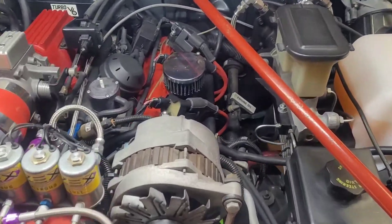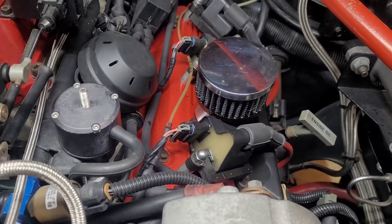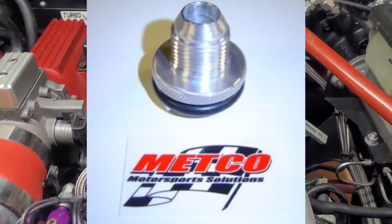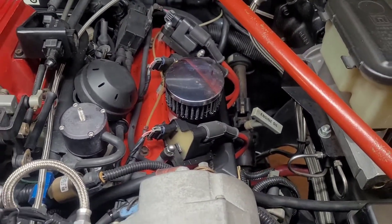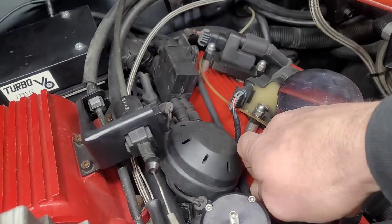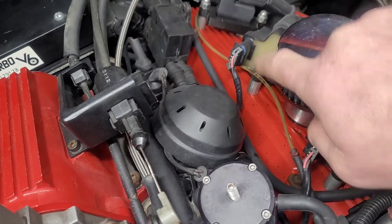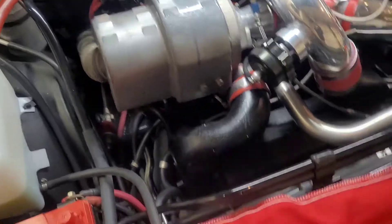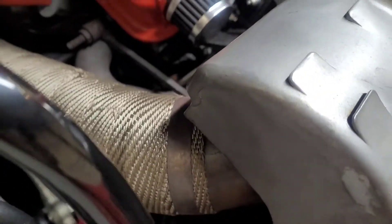For this vacuum pump, I'm going to remove the driver's side oil fill hole breather. When I go to change the oil, I'll obviously have to pull the AN fitting out and remove the line, but for as often as the car is driven it's fine. There's a film of oil that runs down the fins and down the back of the block and leaks everywhere. Over on the passenger side valve cover behind the turbo there's another breather that also has an oil film.